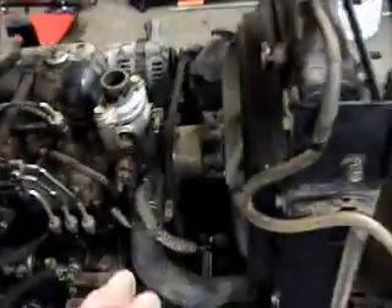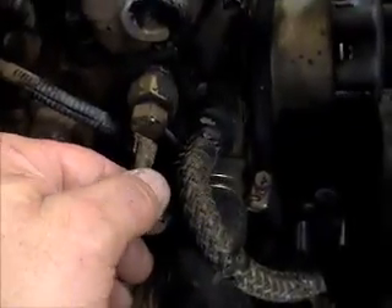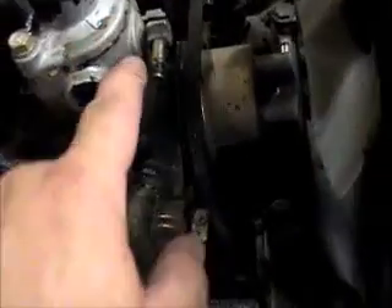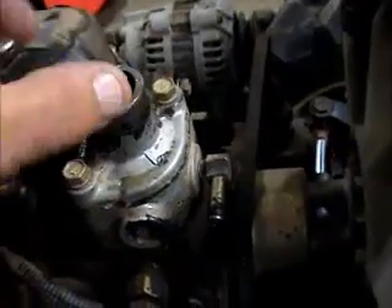I did change a few things from what I said in the last video. I took the battery out, went ahead and took the whole breathing system off — it's just laying right over there. There's the exhaust system. I disconnected the temperature sending unit and disconnected this water hose from the thermostat housing, because this thermostat housing is part of the head.